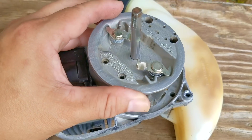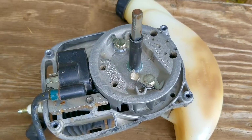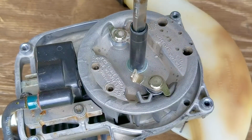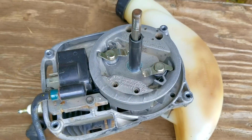Now, I got a lot of great comments on what to do if this repair doesn't get the engine to start, and the best option was to replace the ignition module. They felt the ignition system was delivering either a weak spark or that it was sporadic at best. The problem is that this would have been a great time to have replaced it because getting back to this point takes quite a bit of work.